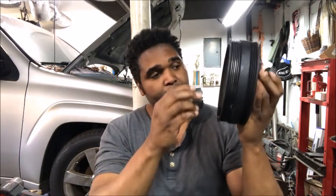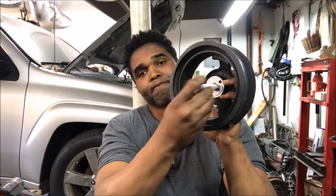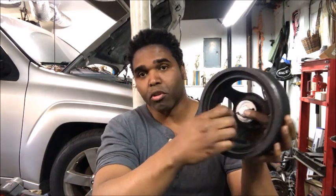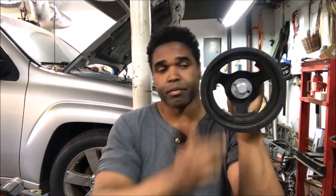So this is on your crank. Take this piece right here, put it like that. You're going to put the bolt through the center and tighten it down. Take your drill bit and you're going to drill in the hole. You could do one — I like to do two. After the hole's been drilled, you're going to take your pin and slide it through the hole. That's it. You just pinned your crank out.